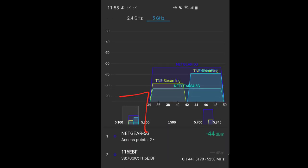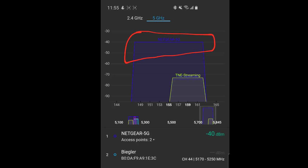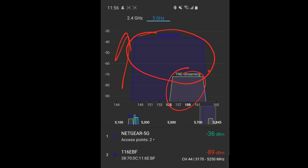If I click on 5 GHz, there's a slider box you can slide back and forth. There's a block of networks, then nothing, nothing, nothing — and then here is my 5 GHz network. There's a big gap between it and the others. Standing right next to my router, I have my own lane with plenty of signal strength above everybody else. This is what you want to see — high signal strength and not a lot of other stuff nearby.